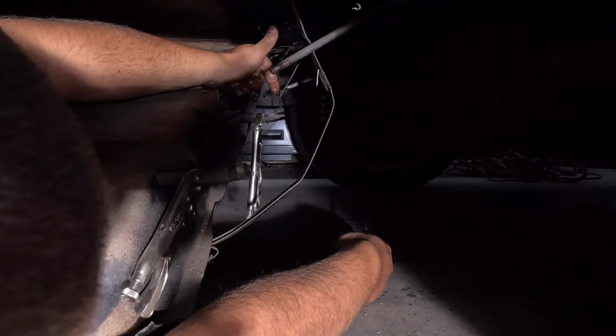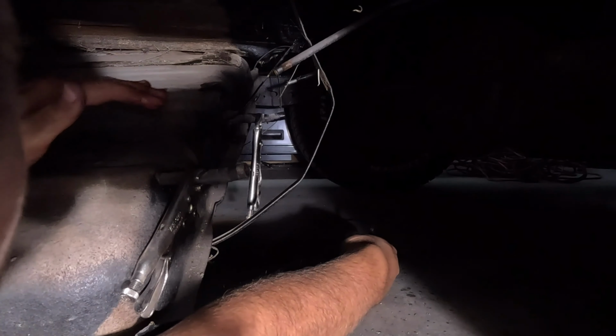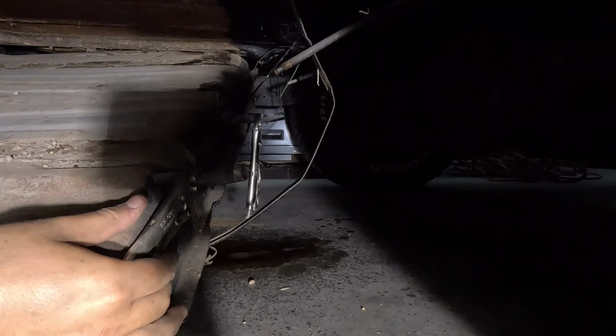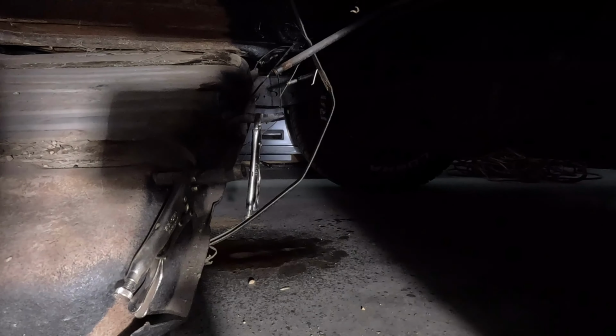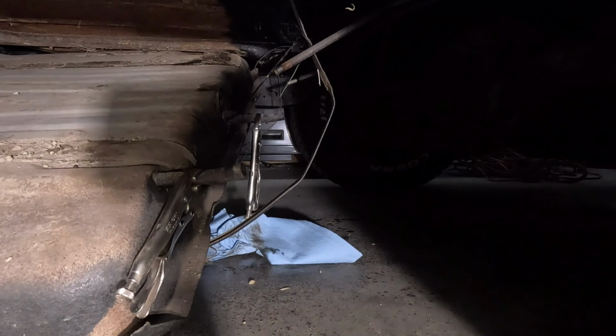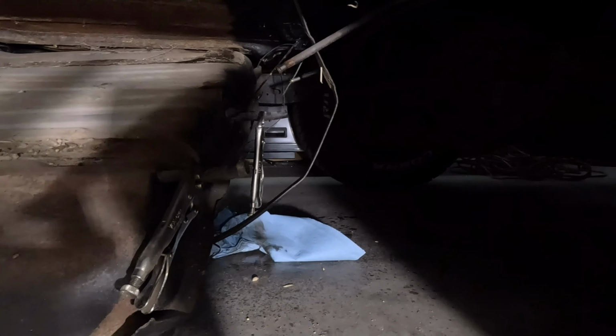Fuel in it. Crap, it burns. Well, that's most of our fueling issue right there, because that gas that just got on the floor is less gas and more dirt. Fueling issue solved. It turns out there's just a bunch of crap in the gas tank, like we thought.